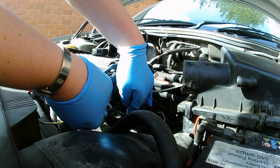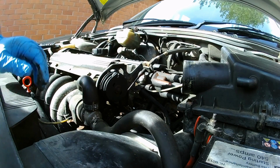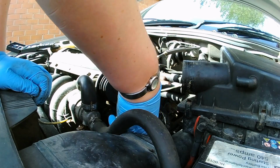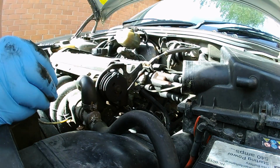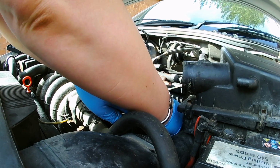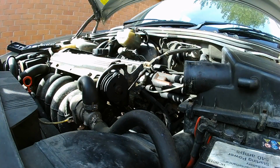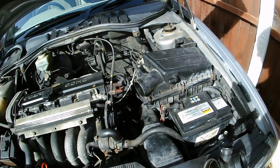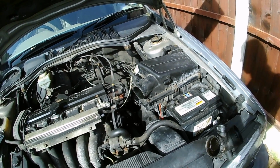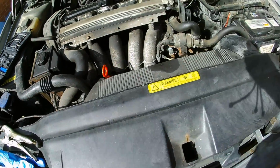Oh, there we go. What we find with these Jubilee clips is you can open them with a screwdriver when they're new, or if they're okay. But a 7mm socket seems to be what you need when they go all corroded and horrible. Really doesn't want to move. It'll spin, but it won't come off. And as usual, the Haynes handbook makes out like, oh yes, just slide it off. It's like, yeah, right, okay. I'm thinking that there's an element of when the engine's absolutely stone cold, everything kind of just nips together or something, I don't know. Well, we finally got it off, and what I conclude from this is that when the engine's cold, like it is this morning, everything's a lot stiffer, and it just wouldn't rotate, and there's not a lot of room to get down there. So I resorted to using a pair of mole grips, just to be able to actually grip it and twist it, and then it came off.